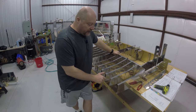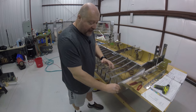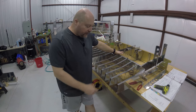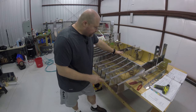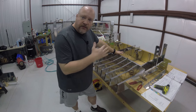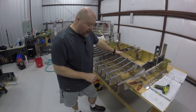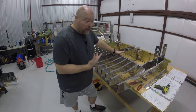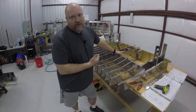I've noticed minor oil canning in wings and ribs before, where I was either able to crimp the edges enough that it went away, or when I clecoed everything to the skins and riveted it, it went away entirely - those ribs were so stiff. But this is really drastic - a lot of oil canning. This piece without the stamped-in gussets doesn't have it, but the ones with gussets do, because that stamping has stretched and smooshed the part giving it more strength. I've reached out to Vans and will find out if this is something to worry about.